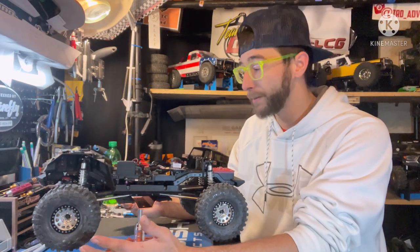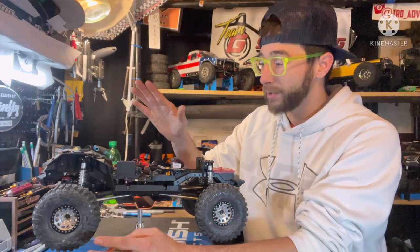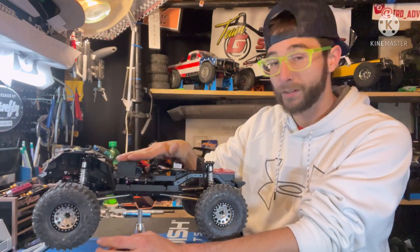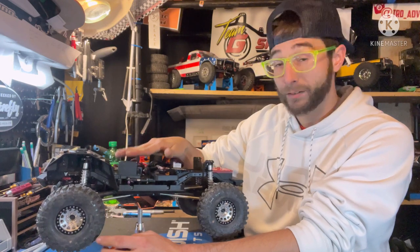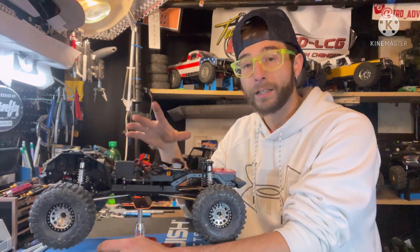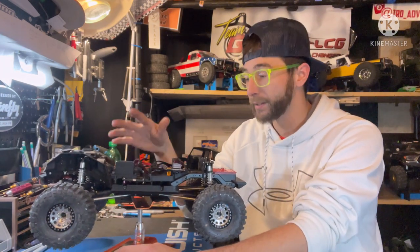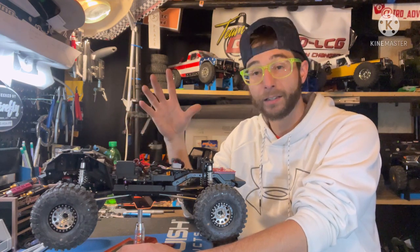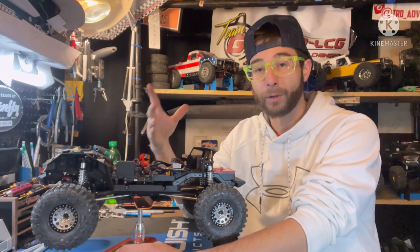If I choose to upgrade to get everything officially matching or find some low-profile servos, those are always options. I've already seen people integrating micro servos for these as well — plenty of servo options out there. Now, one important thing once you get your overdrive and dig servos ready: take your time and set your endpoints. Setting endpoints is going to be very crucial with both — especially the overdrive unit. This ensures you're not putting constant pressure on your servos causing them to overheat, and that you have proper engagement without gear clash when switching between overdrive levels or engaging dig.